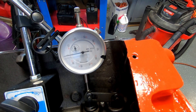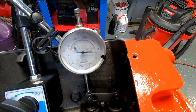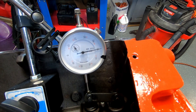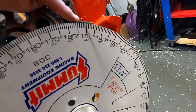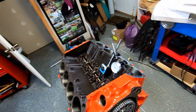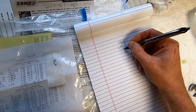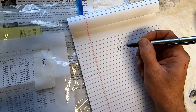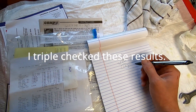I'll go back up to zero — that's fine. Now we're coming up to our 50 — slowly, slowly, slowly. Right there. Touch her down. 152. So we do our math: 152 and 68. It's real simple. 152 plus 68, we get 220. Divide it by 2 — that's 110.